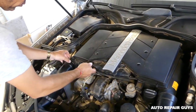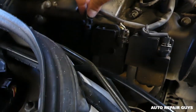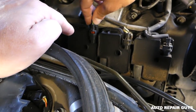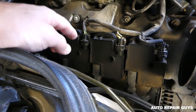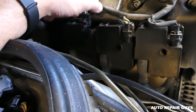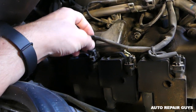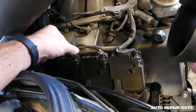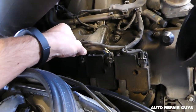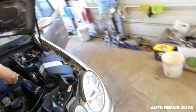Okay, the ignition coil is right here. This wire got loose — check it out, it doesn't make good contact. You've got to make sure you push it all the way in. This one was previously replaced — you can see it should have a zip tie holding the cable. Whoever did it didn't push it all the way in, and from vibrations driving down the road it came loose. We push it in all the way until it clicks and install the engine cover.